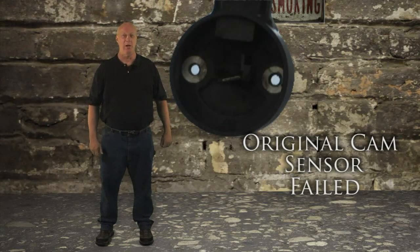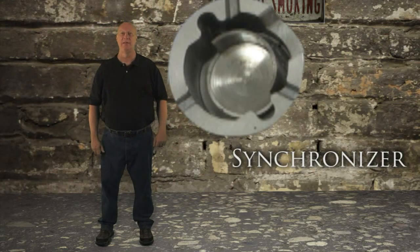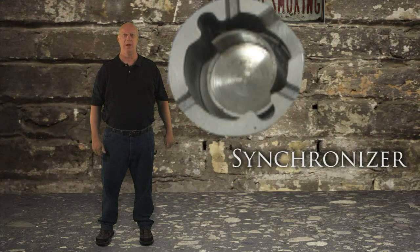There's a shutter wheel or interrupter that rotates around the magnet and activates and deactivates the sensor by blocking the magnetic field between the Hall effect sensor and the magnet. This on-off magnetic attraction ultimately causes the magnet to break loose from the original component.